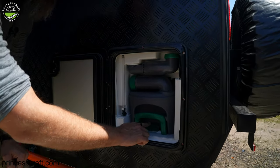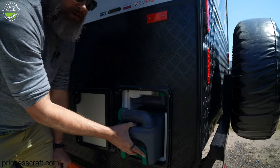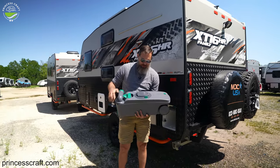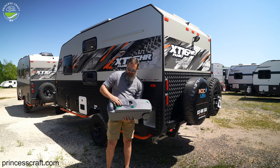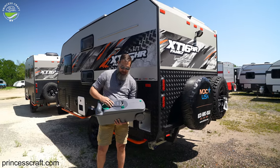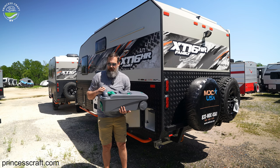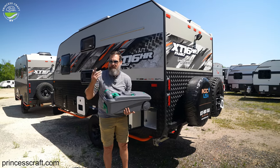You're going to notice there's a little release handle right here — you just pull up on it. Did you hear that click? That click is actually this cover on top closing. When you slide the toilet in and you hear that click, it's opening that cover to make the valve accessible to the top end of the toilet for use. When you hear that click sliding the cassette out, it closes that cover. Let's talk about how to introduce toilet chemical to make sure it works better for you — you won't have as many smells, maybe not any smells coming up.